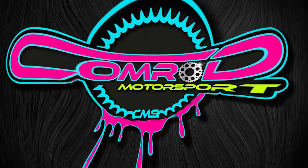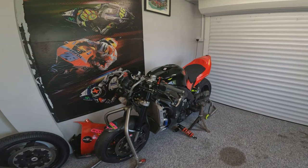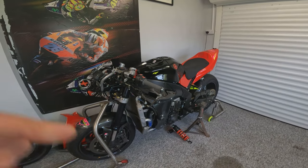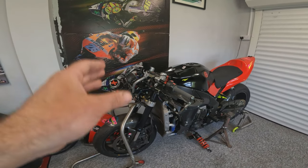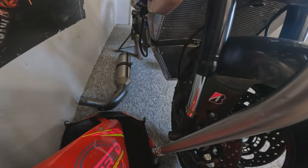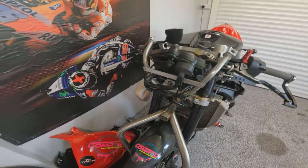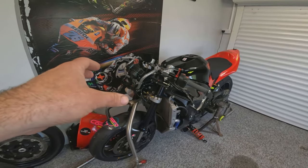Welcome along. Today we're going to be looking at suspension basics on motorcycles and doing a few changes and modifications before an upcoming track day. We've got a 2012 Yamaha R1 — if you don't know the full spec of this bike I'll pop a link in the description. It's been out at a track a couple of times and I've encountered a couple of problems with the front feeling very, very soft, and the fork travel indicator actually going all the way down. The only way of stopping that with full preload wound on is to up the compression, so we're going to make a spring change and a fork oil change in the front.